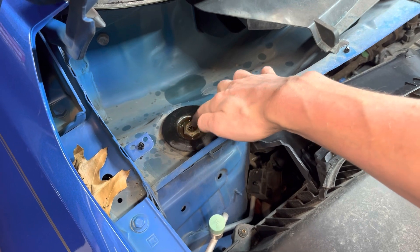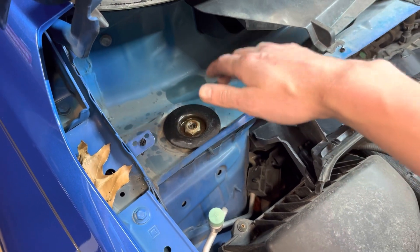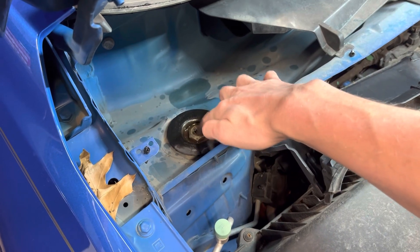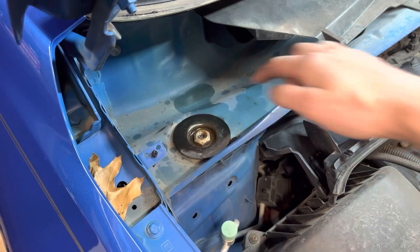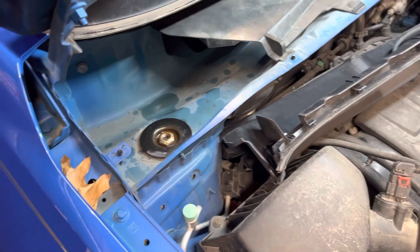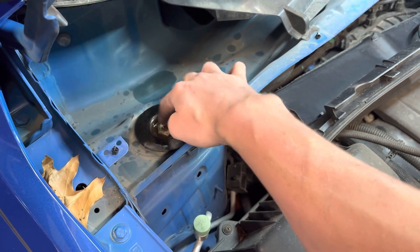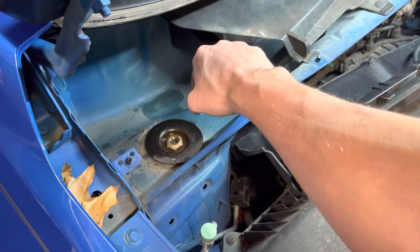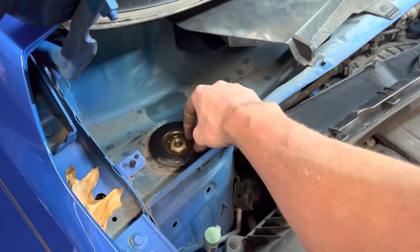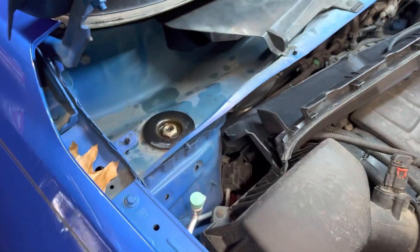In the middle of the rod — I call it the push rod for the shock absorber — is what the nut is threaded onto, and it is a Torx bit. The point of the Torx is you put it in there with a ratchet, hold on to it, get a wrench around the nut, then break the nut free and you can move on.